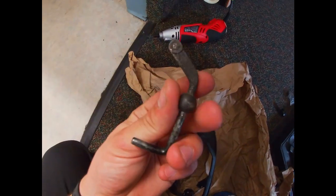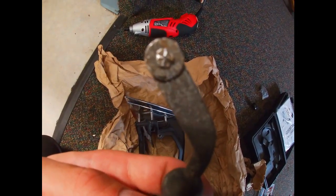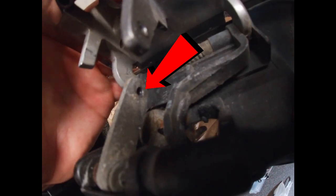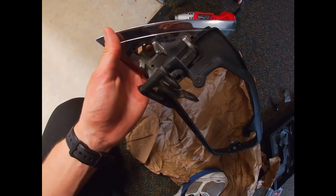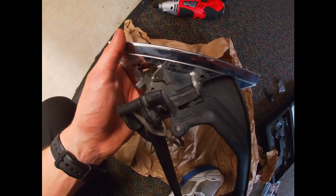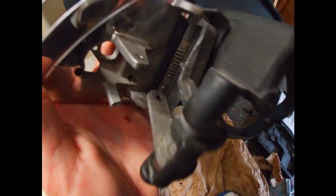As you can see, I removed the handle — this part was riveted into the mechanism but it broke off. I started drilling a hole in there because I'm gonna be putting a bolt and a nut in there to connect the handle to this assembly. If you have an old school Mercedes and you try to move the handle and it doesn't move — don't force it. You have to take the whole thing apart, lubricate it, and clean it, because if you force it that joint is gonna break off and then you'll have a lot more work to do.